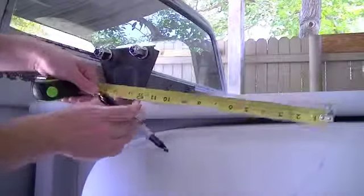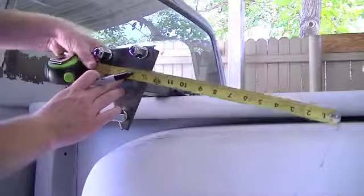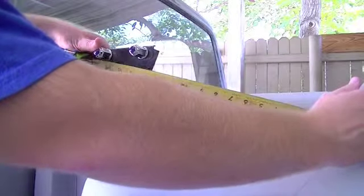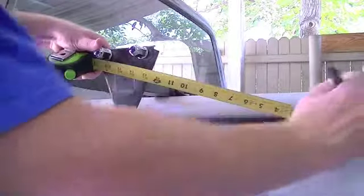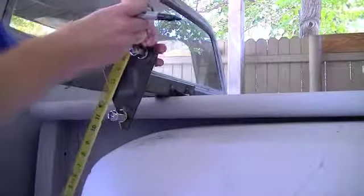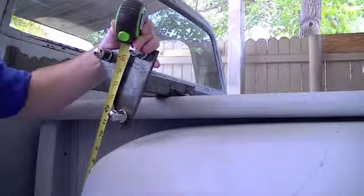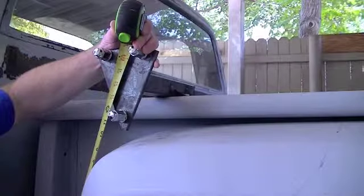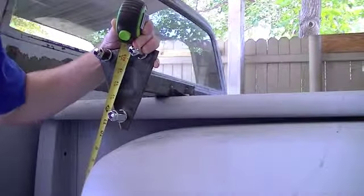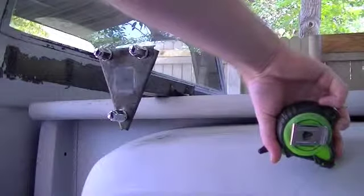So I come in here and put 14.5 on my dot, and then come out here — that's 14.5 out on the fender. I'm going to do the same thing going down, at least try to go down this way and get my mark down here. So now we've got our two points: one up here and one down here low, to cut the arc.